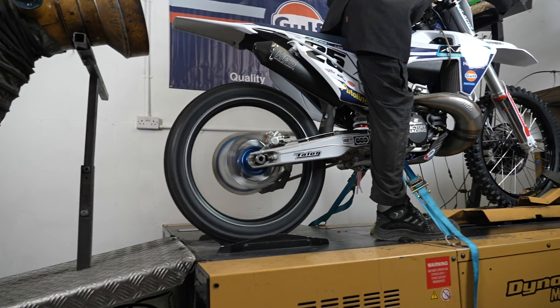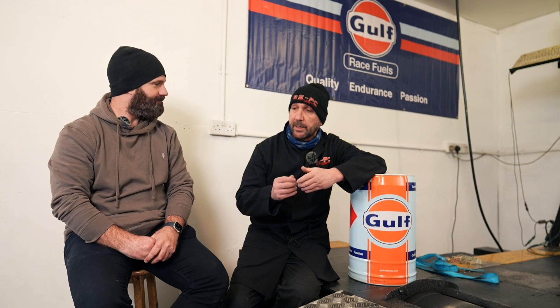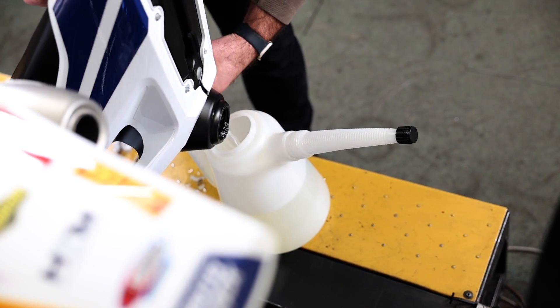You touched on a few things earlier regarding the E10. I can only go by what I've seen — it's an inefficient fuel compared to E5. It doesn't like carburetted motorcycles; they're not designed to run on it. It's hygroscopic, so it attracts moisture. If you've got a slightly older motorcycle, you're going to be hitting issues where the fuel tank is going to rust. It's also got a tendency to make plastic porous. The problem that hasn't turned up yet but it will come is storage — motorcycles kept with E10 over winter are going to be difficult to get back up and running. And it's an inefficient fuel, but we're being made to run it under the guise of 'let's save the planet.'